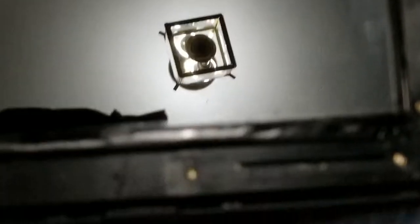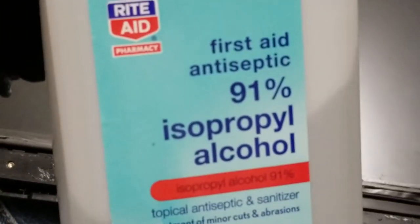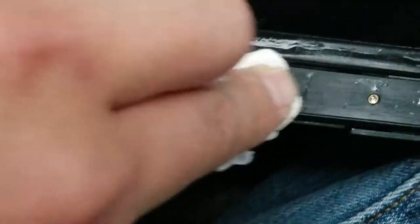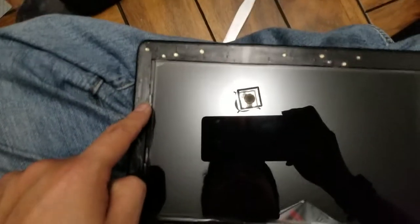After you're finished, there's going to be a lot of adhesive residue on here — it's a pain to remove. Usually what I do is use some paper towels and isopropyl alcohol — 91% or 70% will work fine. Don't use too much, just enough to get it a little wet, then rub it. After it's a little wet, use the dry side. The dry side gets paper towel residue to stick to it, so when you rub again with the wet side it helps pull that residue off. It's a very long process, but make sure to clean it all off — otherwise when you put the new digitizer in, it might fall out.